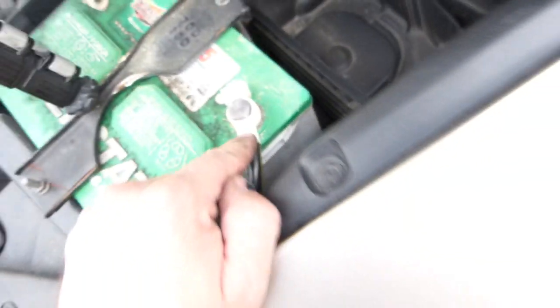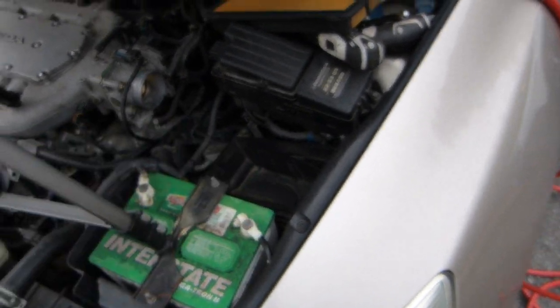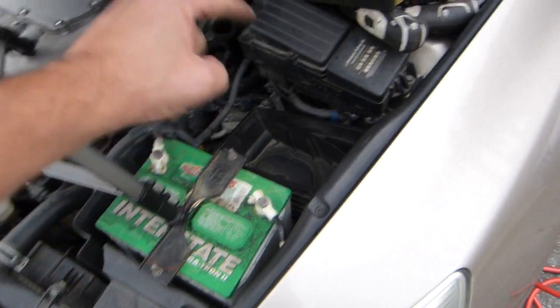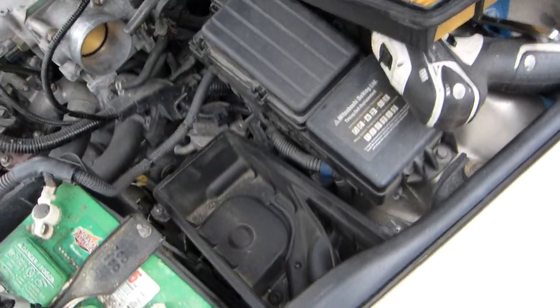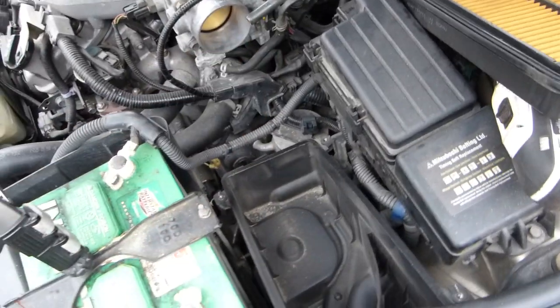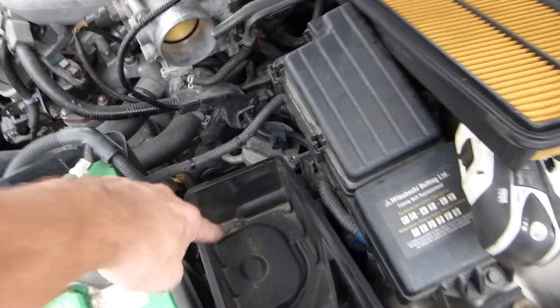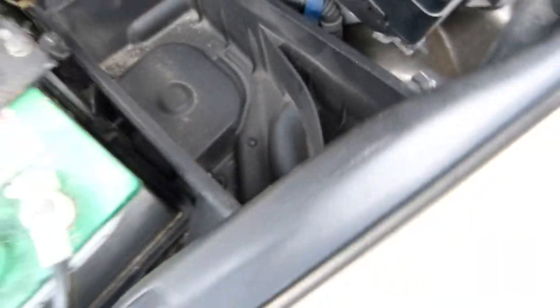Watch the battery terminals or cover them. So that's what it takes in terms of tools and technique. That airbox also needs to be cleaned with compressed air, blowing the dirt out of it while the throttle body is covered. Also this hole needs to be covered so the dirt that's sitting in the airbox doesn't get introduced into the engine. So I hope that makes sense.